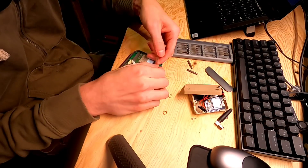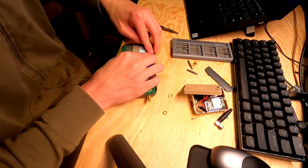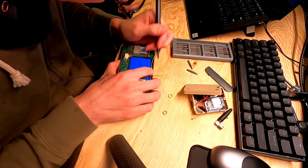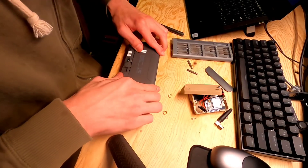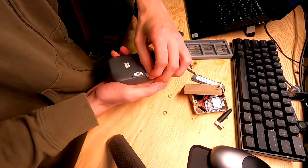Most other modems have the antenna connectors soldered to the card, but this one uses a socketed modem, which is really nice. This also means that if a 5G MPCIE modem ever comes out, in theory you can just swap it in if there's driver support for it. That's a pretty cool detail, and I wouldn't be surprised if they went and did this themselves — it's a really easy way to upgrade a product.